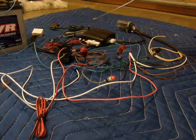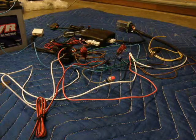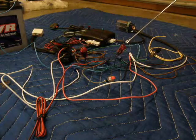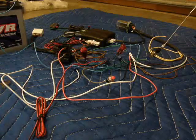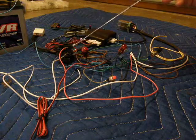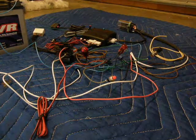This of course is the controller. The flashing LED would simulate that LED in the OEM instrument panel. Here's the antenna, this is the main system interconnect, the relay module, and these lights represent the turn signal lamp and the ignition on lamp. This switch would be for the clutch switch and this switch would be the kill run switch. I have the main power input and the turn signal lamp output coming off the fuse block right now, just for convenience because I don't have a connector for the main alarm connection.